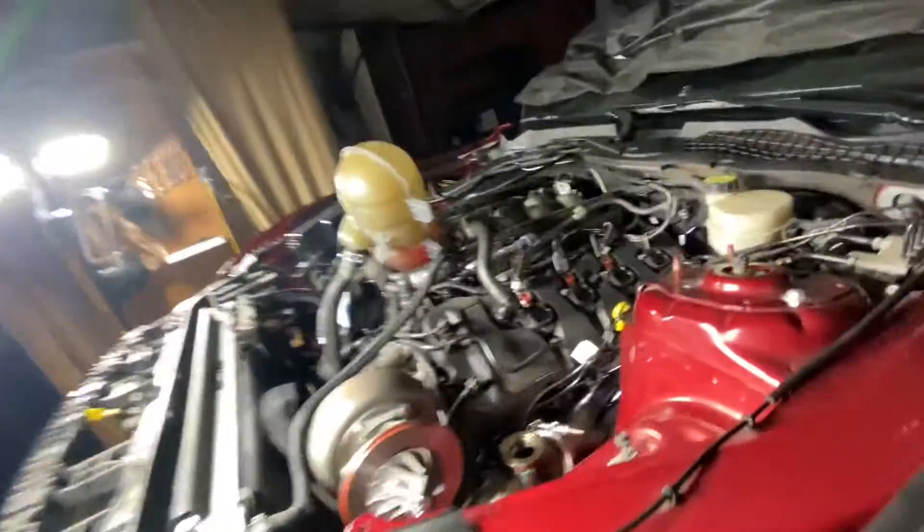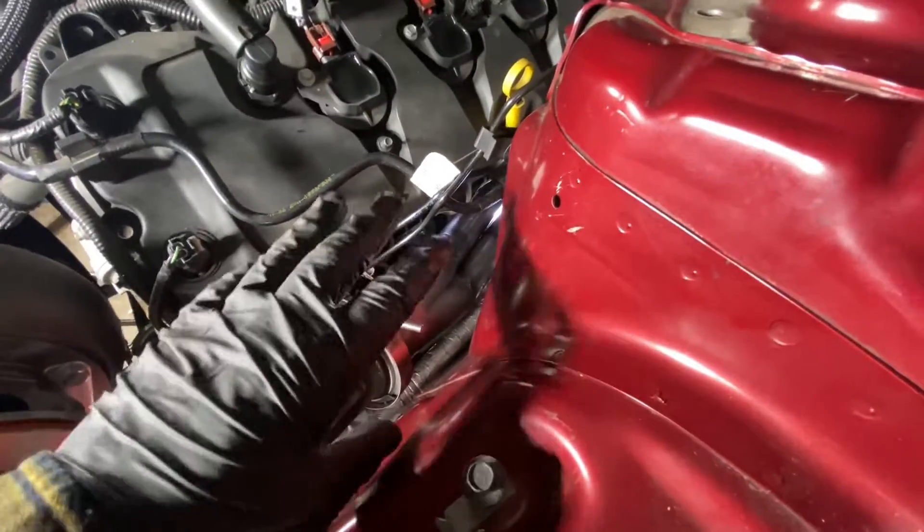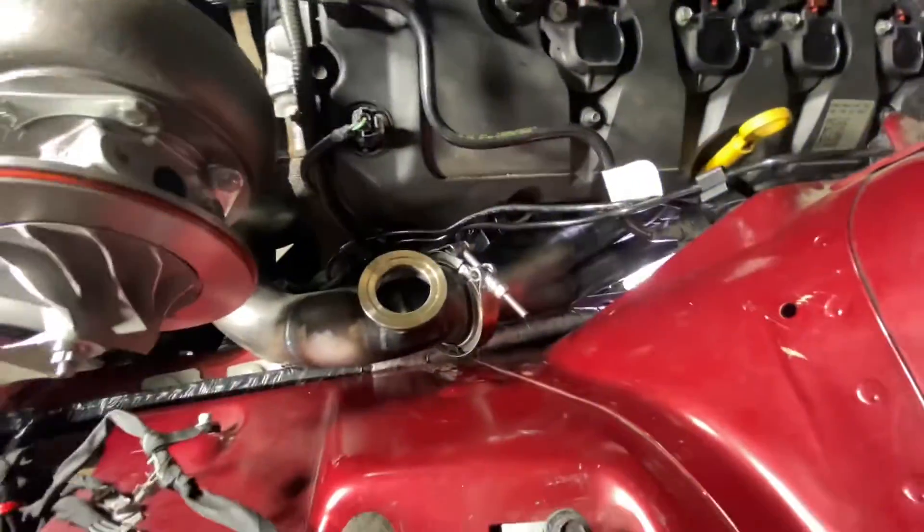I started the install in my last video but ran into a problem with the motor mount bracket that connects to the block. One of the threads didn't get cross-threaded but it looked like it wanted to, so that set me back a couple days. I went and got a good tap set, cleaned the thread out real good, put the bolt back in, and it went in perfectly. When you're working with aluminum, be very careful — threads can easily get cross-threaded. Nothing major though, things have been moving smooth.